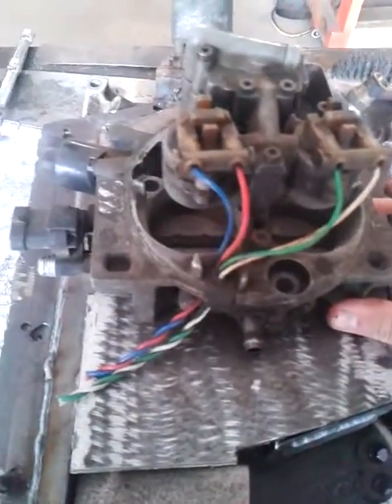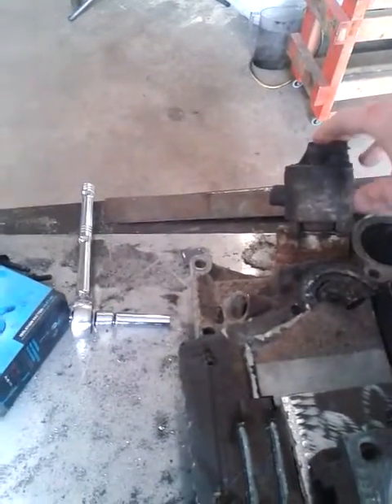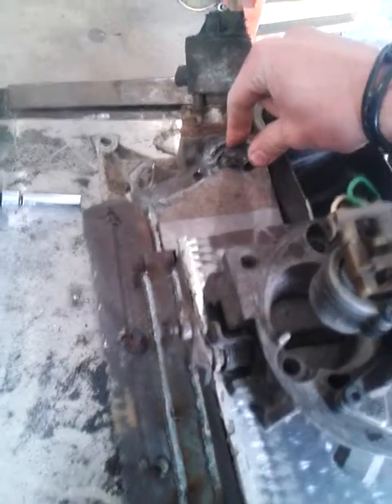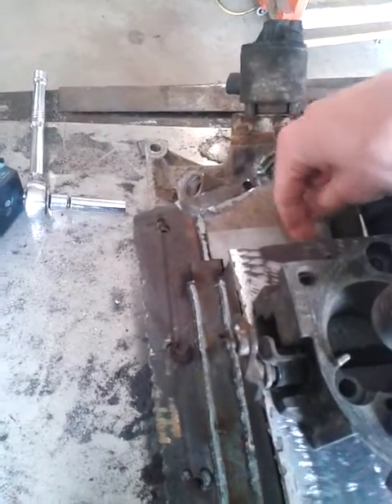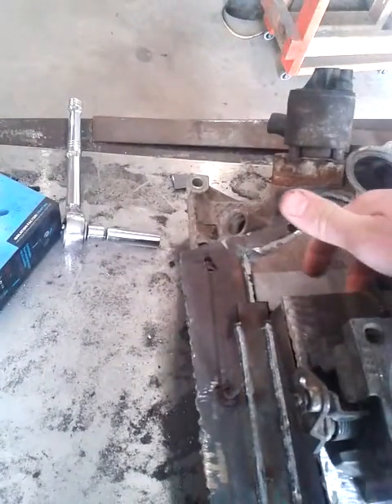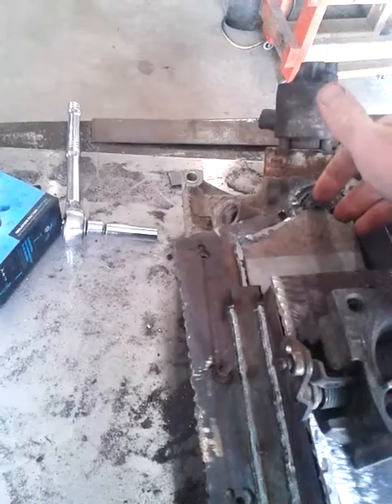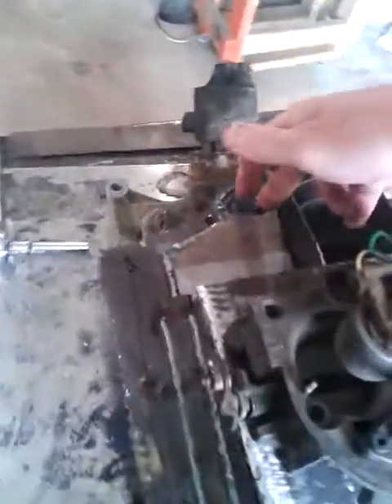I have my 454 throttle body which will be mounted like so — that's the front of the engine. I'm going to leave all these sensors in place because they're just sealing and I don't need them. The only thing is this line here goes to my power steering, so the power steering goes in through here and I'll have to make another little connection into where there's actually vacuum to activate that. I'm kind of going back and forth on whether to plumb it in here because I don't know if it's good to have wood gas going into that, but that's how it works on the engine right now and it hasn't had any problems.